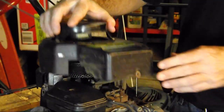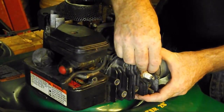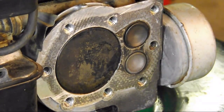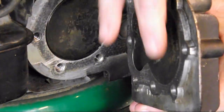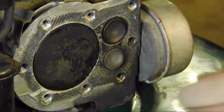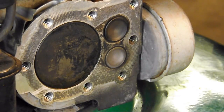I've removed a lot of the bolts already so we can get right into the engine. The first thing we're going to remove is the blower housing, then the spark plug cable. I've already removed most of the head bolts — just that one last one — and the head will come off. There are two types of four-stroke engines dealing with the valves: one called a flat head, where the valves are on the side of the piston and the head is flat. The second type is called an overhead valve, where the valves are placed directly in the head over the cylinder. We'll be dealing with overhead valves at a later time, but I'm using a flat head because it's easier to illustrate the four machine cycles.